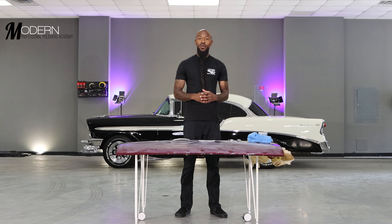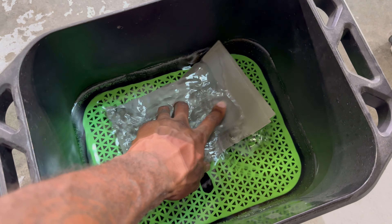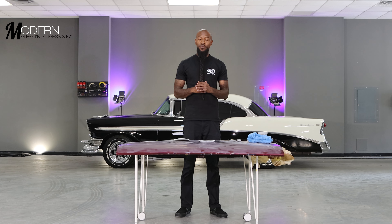The owner said he's probably going to bring the vehicle itself so we can make everything match, and I told him that once we finish this trunk lid there's going to be a huge difference in the gloss. I'm sure once we wow him with this, he'll be bringing the car in tomorrow after it gets out of the upholstery shop. We've got our 1500 grit paper soaking in water right now with a little bit of soap so we can soften up those edges and not leave any sharp cuts in the paint.